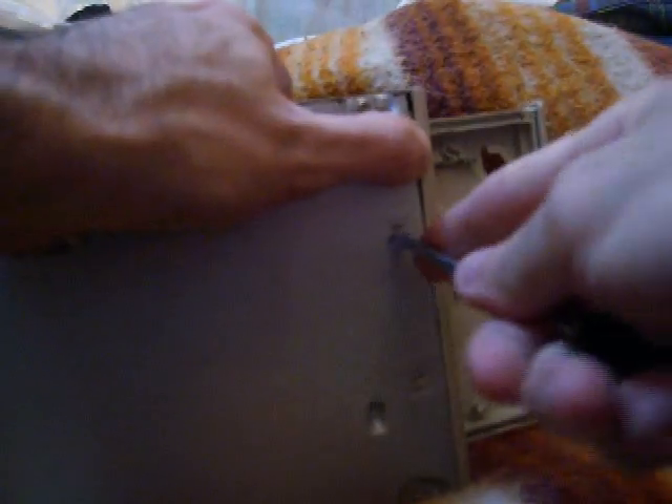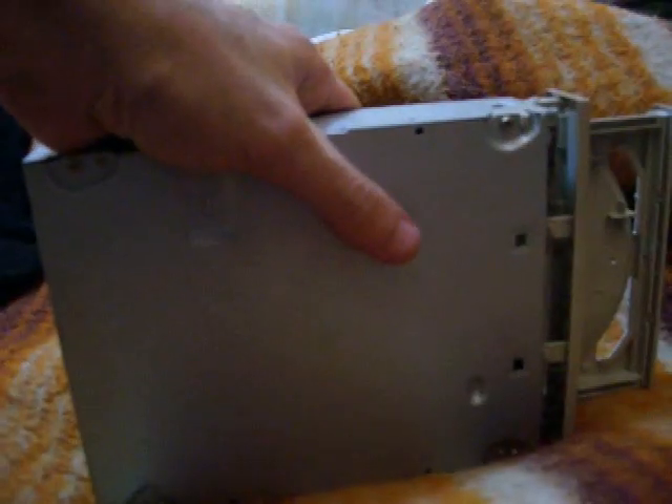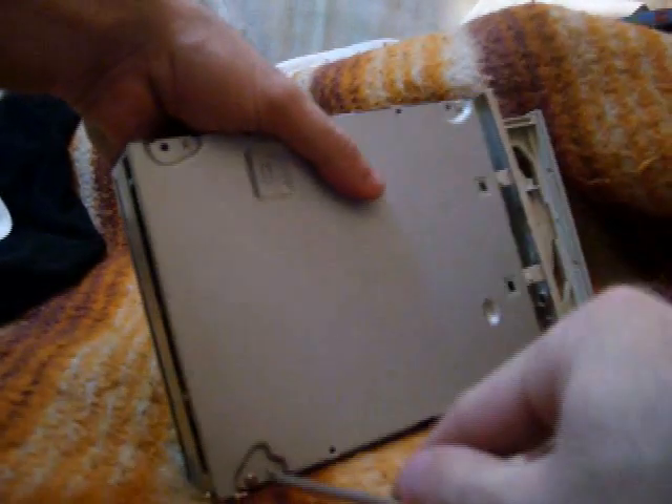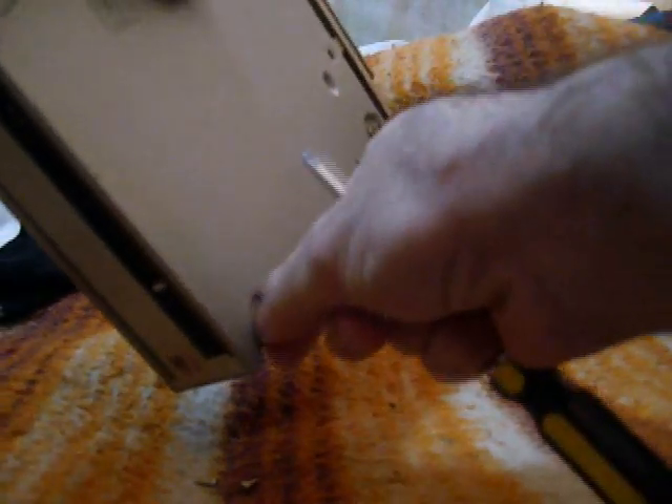I'll start on the bottom part — maybe I have to do both at the same time. I'm using a screwdriver or whatever hard metal thing to push the locks of this plastic front. It's free. Some drives at this point can already be opened by just pulling or pushing the top section from the bottom section, maybe making a movement so that it unlocks. In this case, I will have to unscrew the screws.